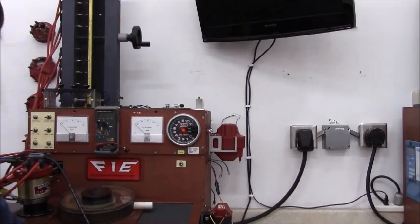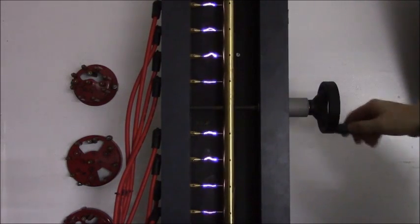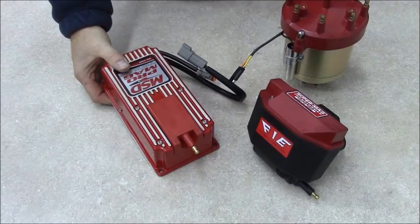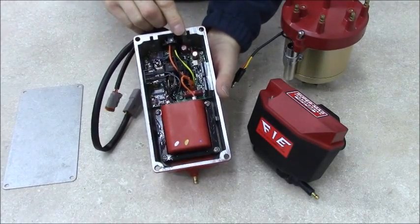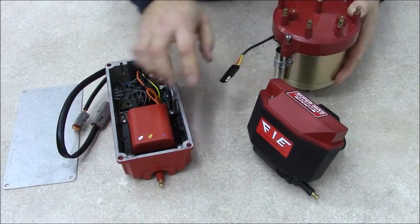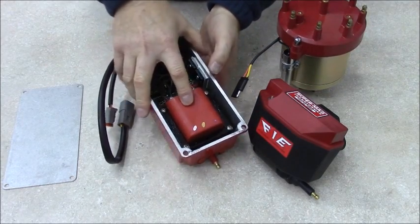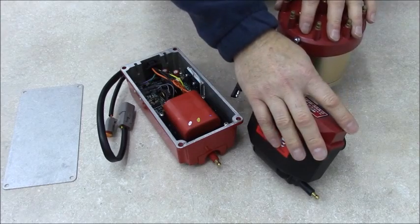Even measuring the mag generators the same using the peak method doesn't quite tell the whole story. The peaks of the Super Mag 4 are 10 amps, and that's a couple of amps less than the Pro Mag measuring in at 12 peak amps. So how can they be pretty much the same at the spark plug? Because other factors come into play in the complete system. The Pro Mag has a points box to blast through, and the box circuit itself is powered by the mag's energy. That consumes some, but the electronics inside also dissipate a considerable amount of energy in the form of heat. That energy is wasted and gone before it even gets to the coil. With this type of magneto, every bit of energy coming out of here goes into the coil and is transformed into spark. Transformer efficiency also comes into play. The tiny coil in the points box can't quite convert the juice like the Super Mag's bigger coil can. That's why this mag needs to put out 12 peak amps to make the same output at the plug that this 10 amp makes.